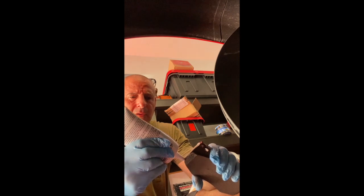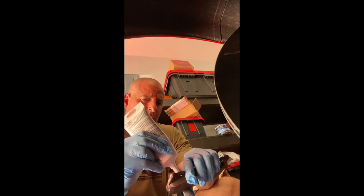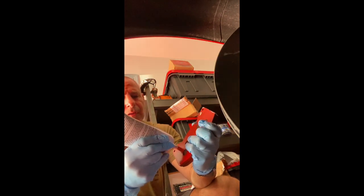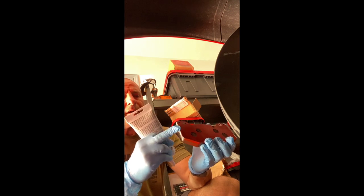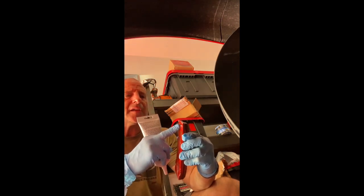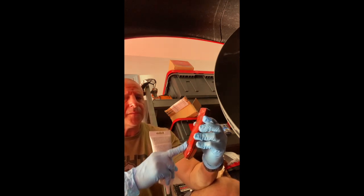I'm applying some ceramic silicone lube into the spots where the pins go and along the outer edges of the brake pad. I'm also putting a light coat on the back plate to help avoid squeaking. The last thing I want to hear is a loud squeak when I'm driving my Corvette, so just a little bit of lube there.